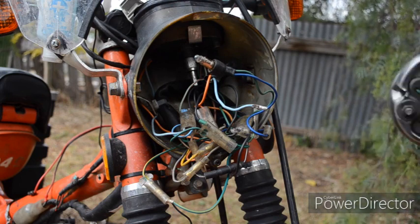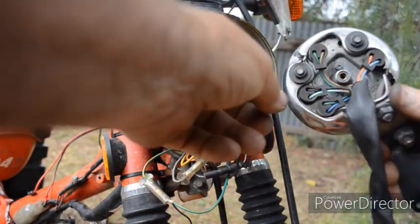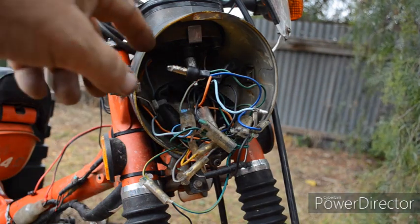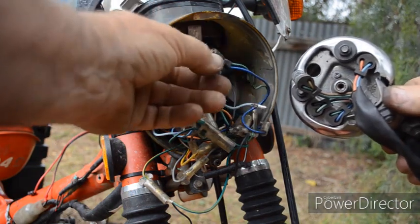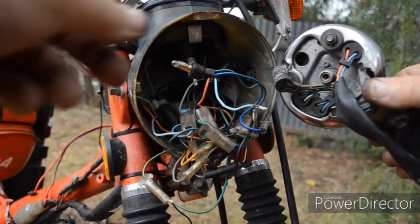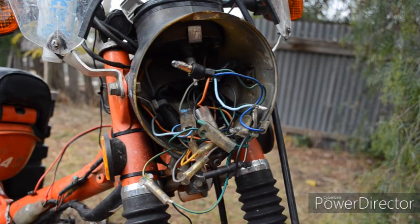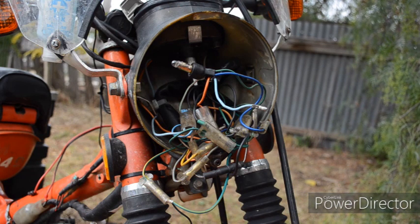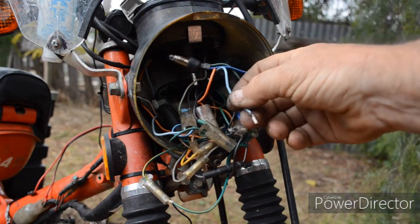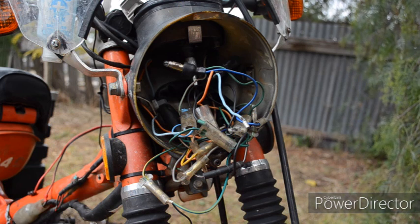The challenge I've come up with is I've swapped the globes out for 12 volt globes, but on the high beam indicator it's a different globe, and the holder won't fit into this headlamp. So what I'm going to have to try to do is source a different 12 volt bulb for that, or modify the holder in some way. Other than that, everything seems to be coming along fine. Just the last wire to connect up for the buzzer — a lot of people disconnect the buzzer anyway — and then I should be pretty close to having a start.